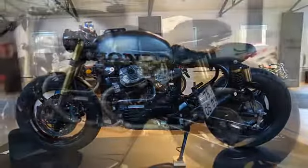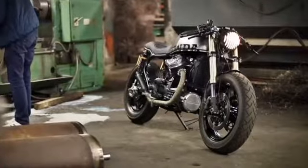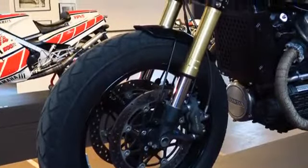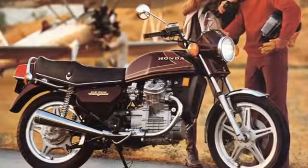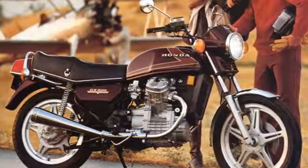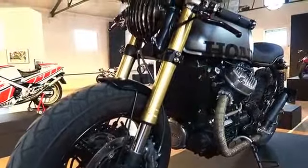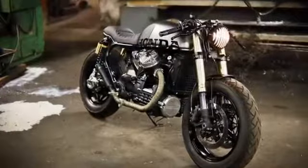And why does this CX500 seem to look better than most? This project made me realize that there's a subtle thing that makes a huge difference in this model. And here's the answer: the upside down forks. If you look carefully, the standard Honda CX500 looks wider and shorter than most motorcycles. This is why the factory front end looks too thin. But these front forks solve this problem — it makes everything look more proportional, not to mention modern. And before you ask, this front end came from a Suzuki GSX-R, including the wheel and brakes.